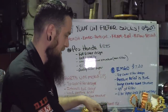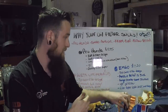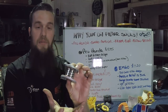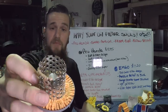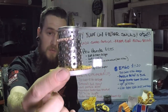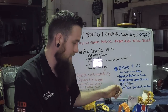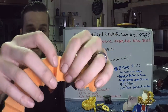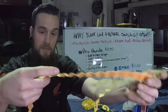The Emgo — this is a very cheap filter. It's probably the bottom-line filter that you can get, along with Parts Unlimited. The top filter cover design just had a regular metal top, so oil's coming in hard and then going around the filter and then being filtered. The center design looks very cheap to me. The glue on one side came right off no problem when it comes to that top cover. The length of the filtered paper came out to 49 inches — shorter than the Honda one — and it just looks like regular paper, a single layer. Nothing to it.